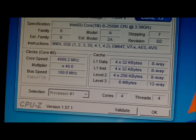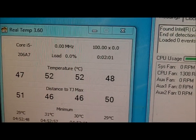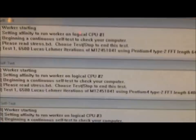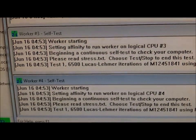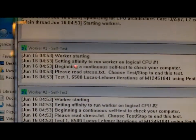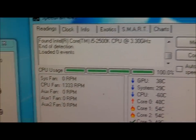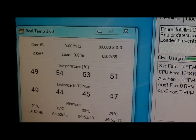We are up at four gigahertz. So far these temperatures don't really worry me at all — for four gigahertz, that's really pretty good. Running the test now, at four gigahertz under full CPU load it's barely even hitting 55°C. This is with the Zalman CNPS9900 CPU heatsink in a Cooler Master HAF X 942, using the Zalman Super Thermal ZM-STG2 thermal grease.